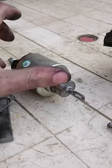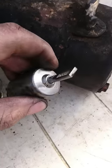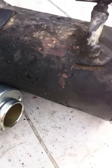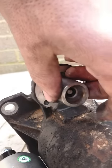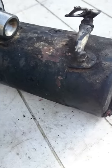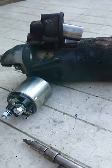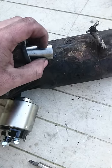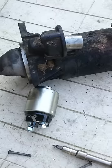I'm going to fit that onto it now. When you put it together, the easiest way is to take the spring out of the new actuator rod. You'll see in the back of here there's a lever and this flat end hooks on there. Then put your spring in, slide the new solenoid body over the top, do your connections up, put your three screws in, and that's it. Put a little bit of thin grease or engine oil — not much — on there just so it's got some lubrication, and you won't get any trouble.